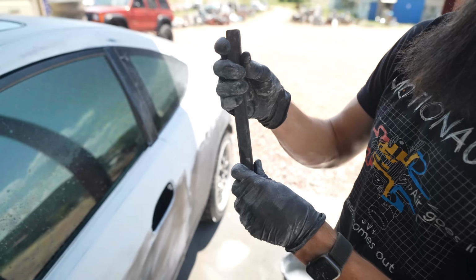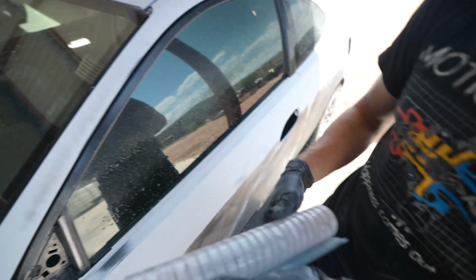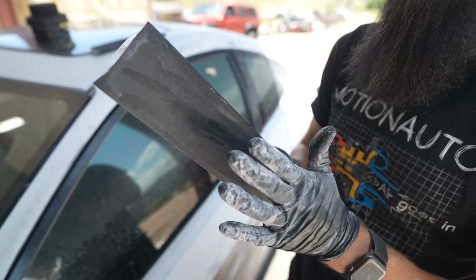Another day sanding on the RSX. It sat for a day or so. Basically what we did was finish it in 400 grit, but we were blocking it with the Durablock, which is a foam block, so they're not as straight. I got some Facebook ads for these things. These are called linear blocks, and they have a sticky backed 600 grit wet sanding paper.